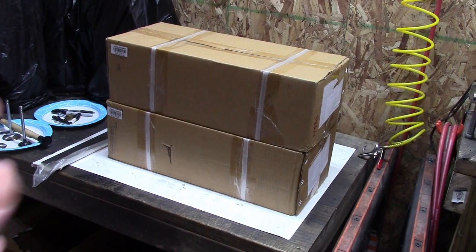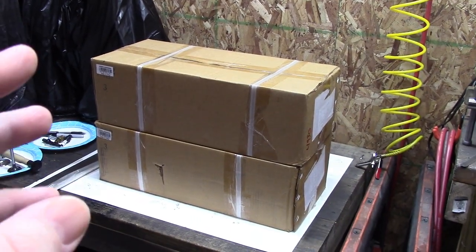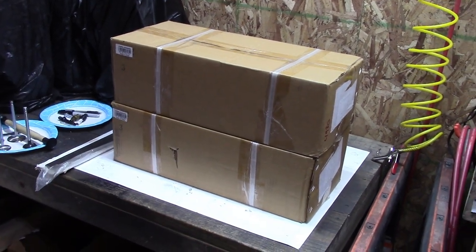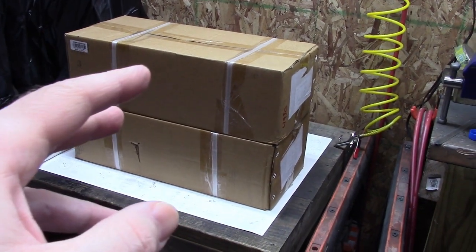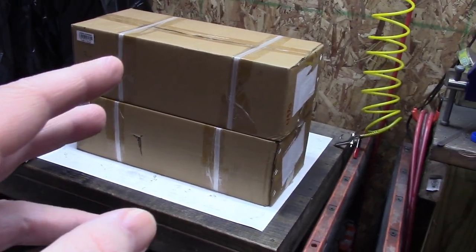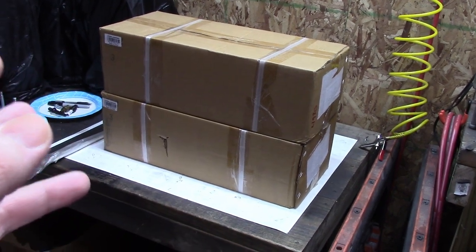You may have noticed there's one difference between these heads and past sets I bought. These boxes are brown. In the past sets of heads I bought, the boxes are white. The reason is, I've only bought one other set of heads that had brown boxes, and those were the 2.0 heads, which had the dual intake bolt patterns — Vortec and Standard 12 — and they also had standard ports. These heads are supposed to be those heads, and I got them at a good price. I think I paid $184, and they're now $196.